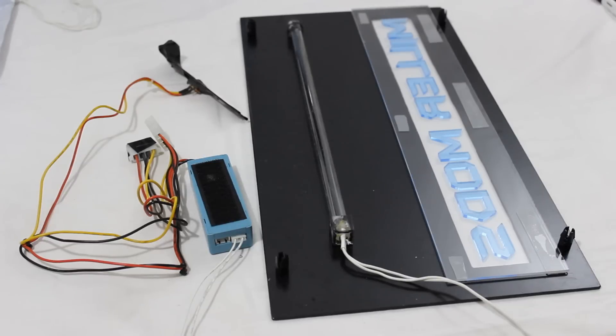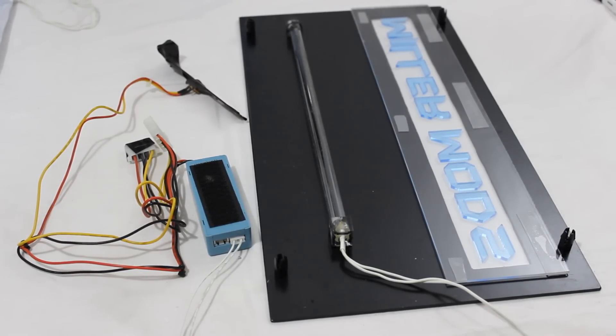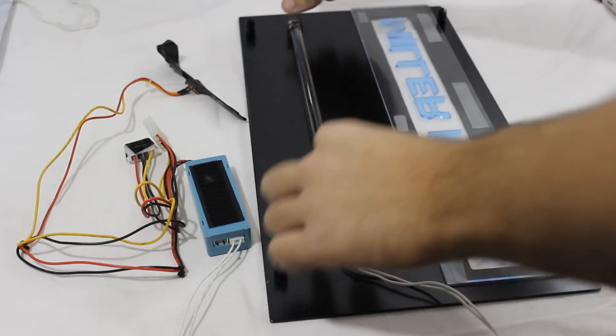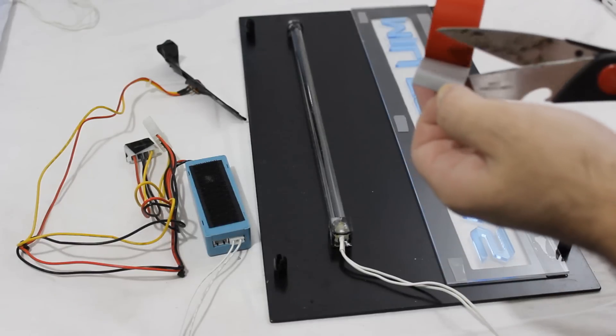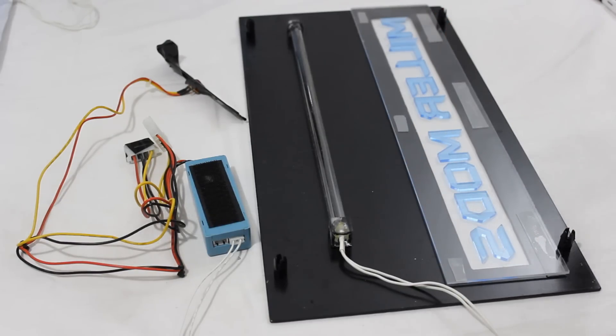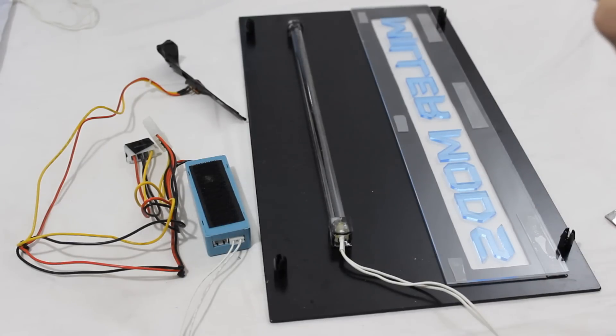At this point I'm basically finished, but I want to add the cold cathode behind the plate. To mount it I'm going to have to take the dust filter off the 900D to allow not only the wire to fit but also the cold cathode itself. I'm not too worried about losing the front dust filter since I don't have any intake fans up there anyway. I'll use double-sided tape again to mount the CCFL right to the back, and then run the wire straight to the converter to power it — that'll be tucked away behind my 480mm radiator at the bottom of the case.